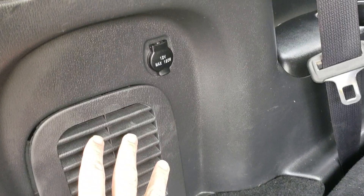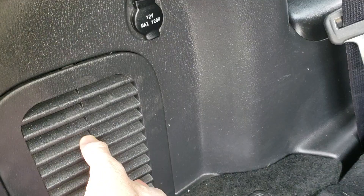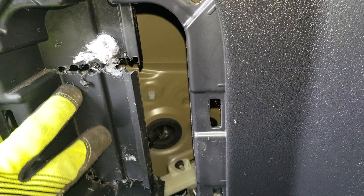Over on the driver's side you can see a grill right here — I've already popped this off. The best way to get this off is to put on a good pair of gloves and, using both hands, just pull straight out and it's gonna pop off. It's just held on with some clips. Unfortunately Nissan has put a piece of plastic still more in the way than you need.